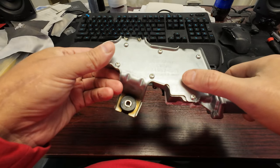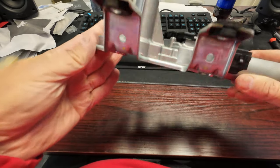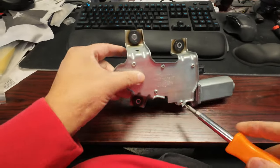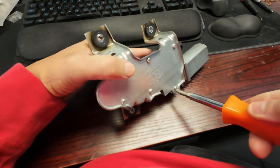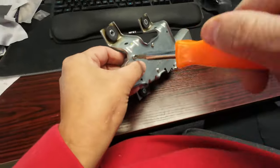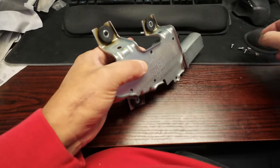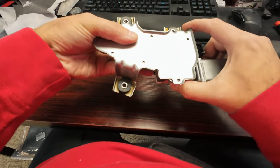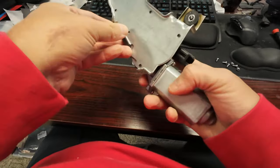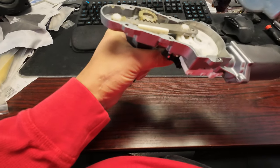There's a model number — made and assembled in Hungary. This is essentially it, and this is the thing that costs three hundred dollars. We're going to remove all these screws right here and see if the gear is okay. Pull these six screws out — it should just pop out, you may have to wiggle it a little. Take off this cover and you'll see a lot of grease.